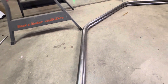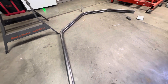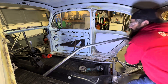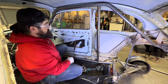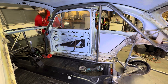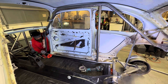We have two matching tubes ready to be installed in the car. One thing I should have mentioned earlier is I'm designing this roll cage to be able to remove the body. Once I get all the tubing installed and I'm happy with the fitment, I'll remove the body, get it all painted, and finish welding all the internal structure. Now I'm getting things lined up, squared up, leveled off, and ready to tack.